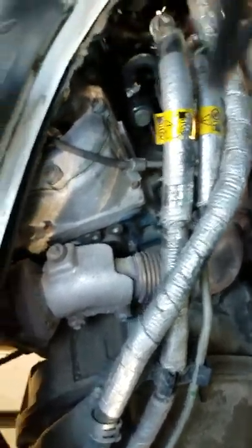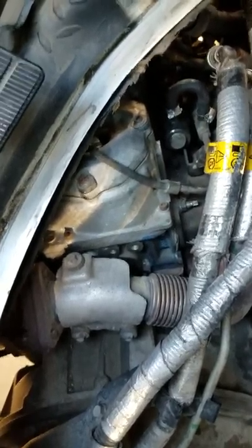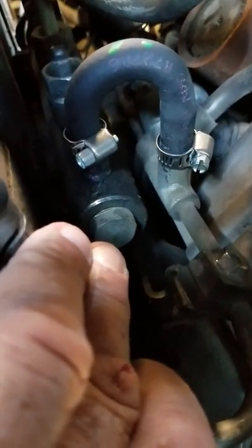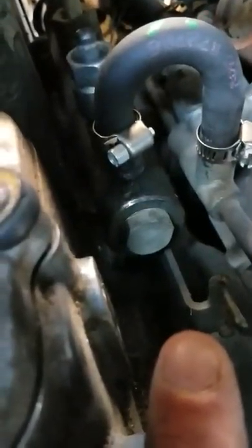We've got to find out where we're losing 6,000 pounds of fuel. With these trucks, it's common knowledge to technicians that it's a bad injector returning fuel back to the tank. First thing you want to do is check the fuel pressure relief valve right here on the rail. Take one side off the rail, clamp it with vice grips, start it up, and see if fuel comes down the rail. If it does, that's where you're losing pressure. I did that first.